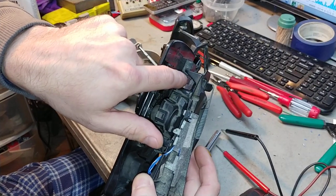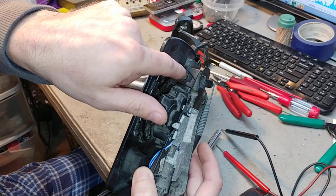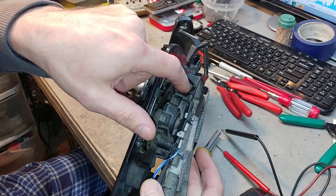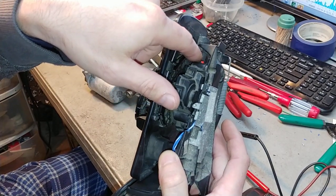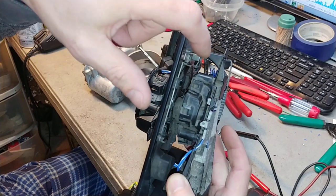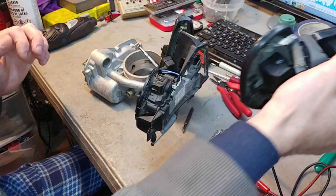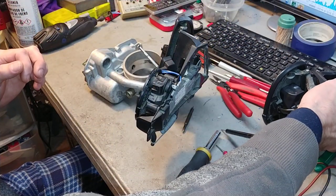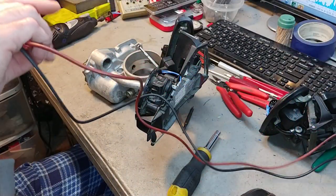It's important to know that these little guides remain behind the wires — you can see the wires are there. Once the mirror opens up, the wires end up here, not where they are when collapsed back in. So just be careful with that.